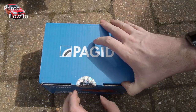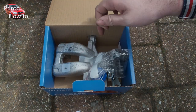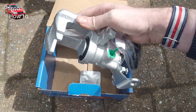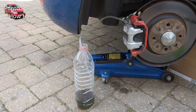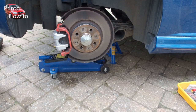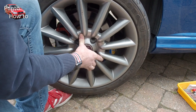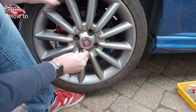So second time around I bought a new brake caliper. This time I went to a reputable supplier here in the UK through their website, and this was a reconditioned Bosch brake caliper — a caliper that had been used, made by Bosch, but completely stripped down and rebuilt with all new components. So after two brake calipers, a lot of messing around, hours of adjusting handbrakes and bleeding the brakes repeatedly, we're putting the wheel back on for the final time for this saga. The work involved changing brake calipers, changing the brake pads and discs, and bleeding brakes repeatedly.